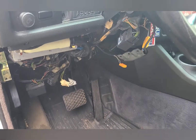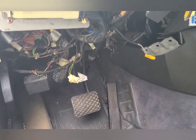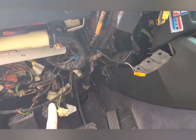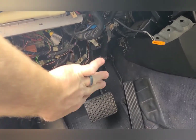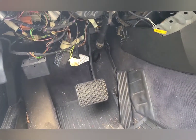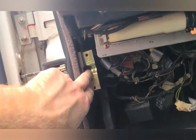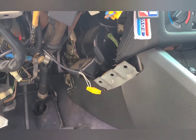This isn't going to be a full in-depth how-to, but I do want to show you the key takeaways. This is a '91 airbag car, automatic — so it may be different on other models. There's a trim panel here with three Phillips head screws and two 10mm bolts. Then there's a big pad across the top held by two 10mm bolts on one side and three 10mm bolts on the other — get all that stuff removed.